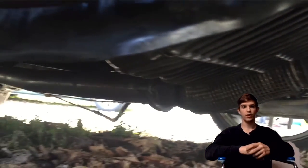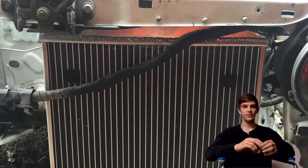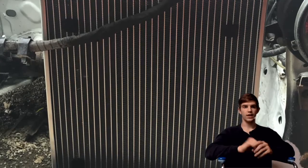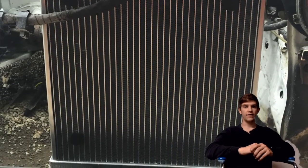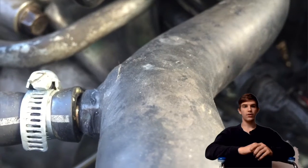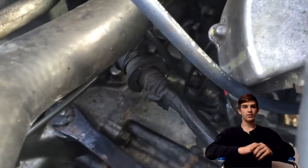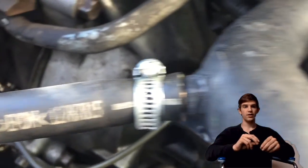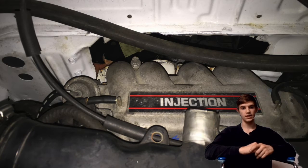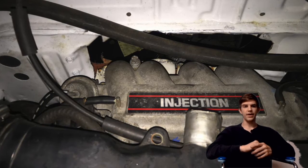For coolant, I got one side coming from the water pump area and the other side going to the other side of the turbo coolant. I couldn't find a T-fitting at any AutoZone, so I just cut a hole in the tube, took a brass nipple fitting, put one part through the hose, screwed in the brass nipple, put some sealant on it, and it doesn't leak. It's a bit rough but it works.